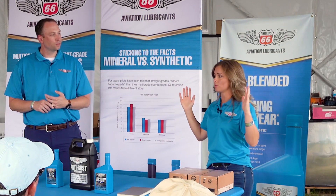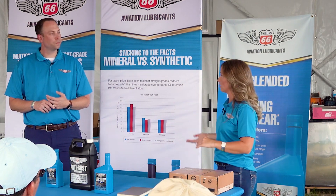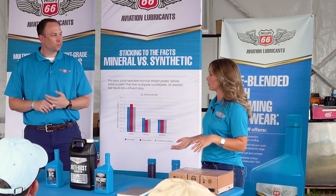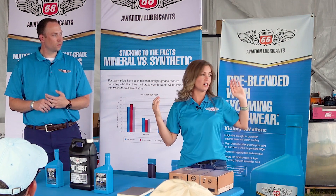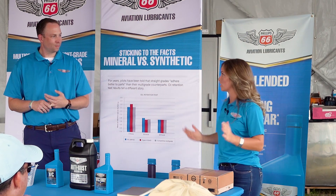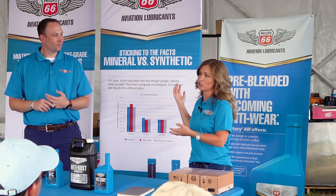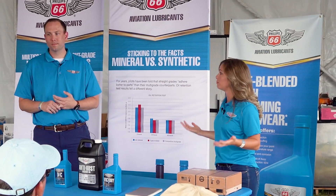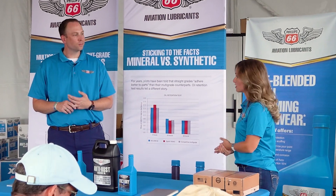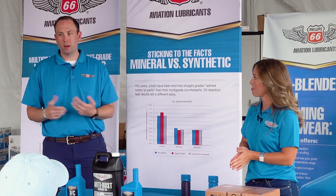Then you'll back your valves, because at any point in time there are valves open on the engine depending on where the crank or cams are pushing the lifters down the valve train. You'll back those off and allow it to fully seal your engine. This is how we have engines that can come out of storage off racks from World War Two and you can open them up and there is no corrosion — because they did an extensive pickling process throughout.